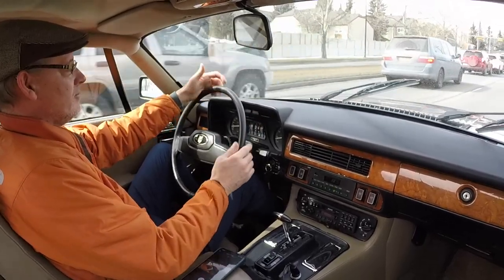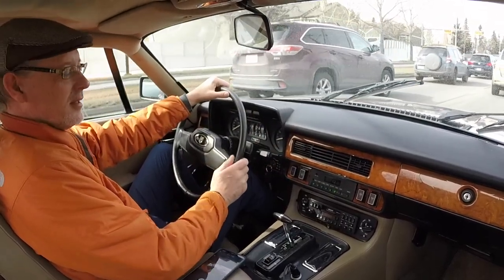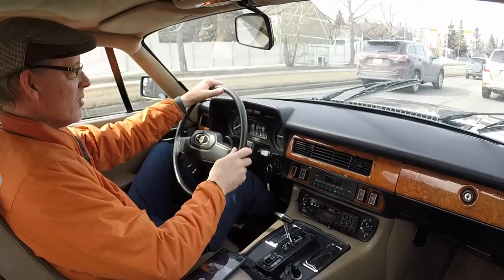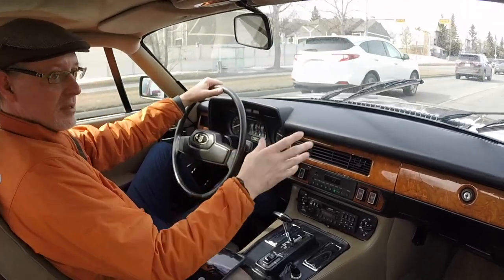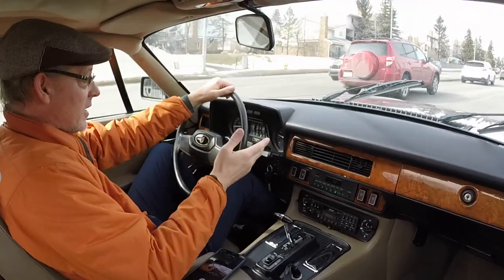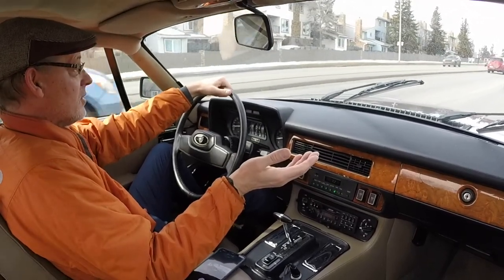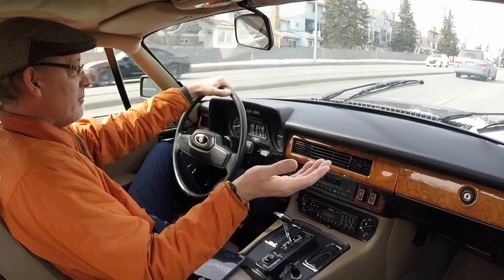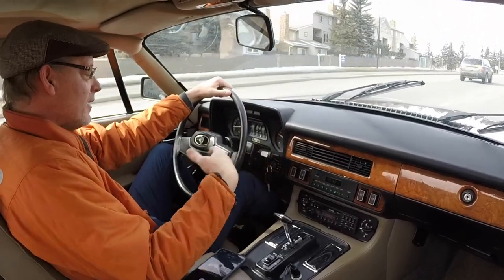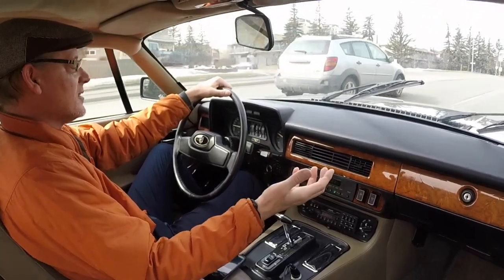I can't tell you how many Porsches have had to deal with catastrophic problems, either 928s with their crankshaft machining the way through the crankcase, to Cayennes with bore scoring issues, to 911s with bore scoring issues, to IMS failures. There's lots of cars out there. Each car can have catastrophic problems. This one doesn't, but others do. So the car, I think, just has kind of a bit of a bad rap, mostly because it requires knowledgeable regular servicing that's neglected in many cases.